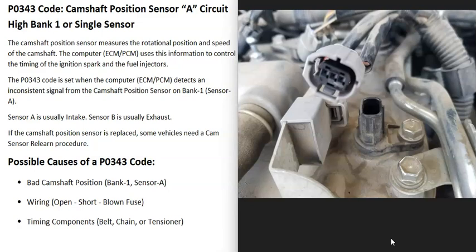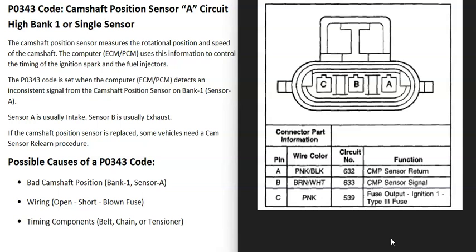The other main cause is the wiring, so you can test the wiring first to be sure it's good. If it checks out, then swap out the camshaft position sensor and go through any relearn procedure the vehicle may have. When checking the wiring, it's a good idea to get wiring schematics for your particular vehicle since there are differences. Sometimes you can find them for free using Google Images; other times they can be hard to find, and there are paid options linked in the description.